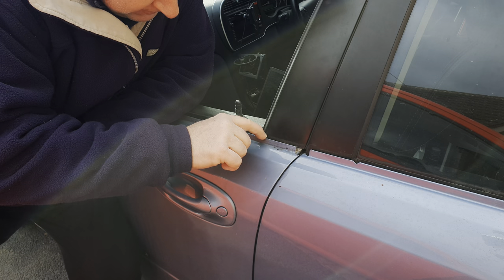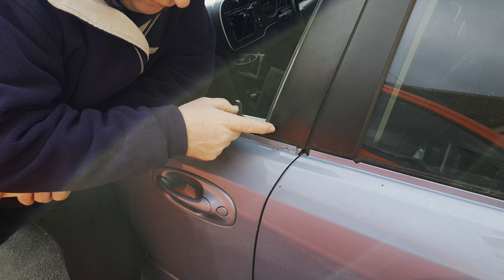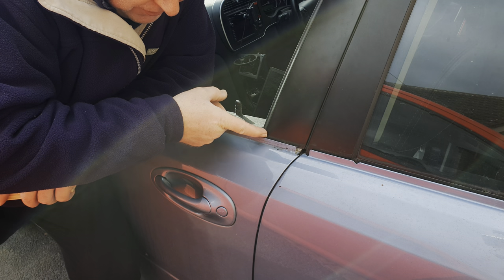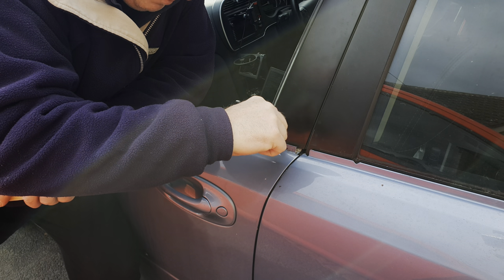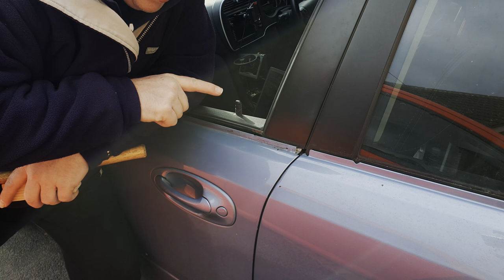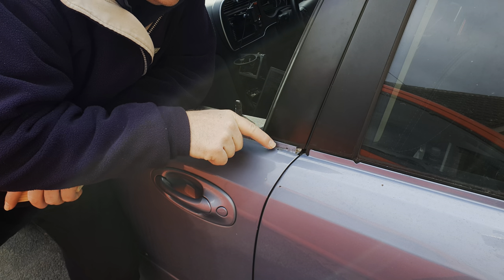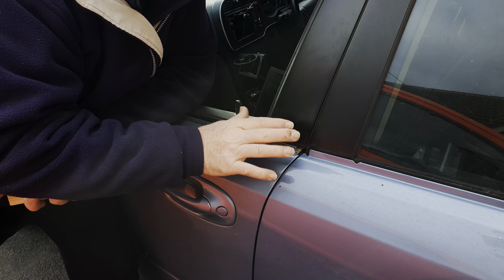At the back end of the door I can tell there's a very slight air gap between the seal and the door frame because there's a lot of dirt on the frame down there, which would be inside the seal. You can bet that if water and dirt can get in there, so can air traveling past your car at 70 miles an hour creating wind noise — so all of that is an area you want to seal up.